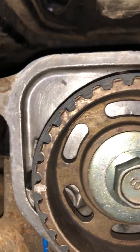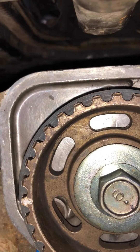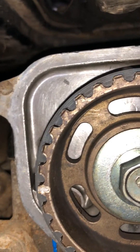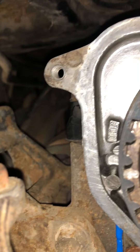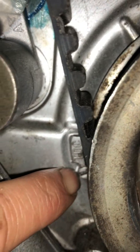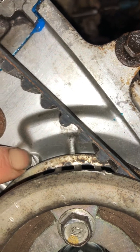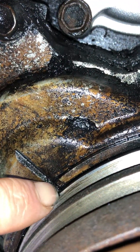I'm under the hood of a 2000 Toyota Coaster with a 1HZ motor and I'm doing the timing belt. See that white mark — that's aligned to top dead center. Notice there's another little nut around here, and the same down here: you've got top dead center and that little nut there at about 11 o'clock, nearly 12 o'clock.